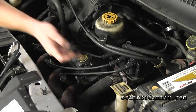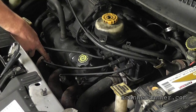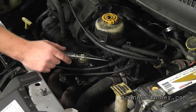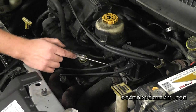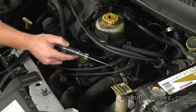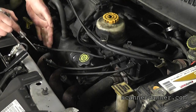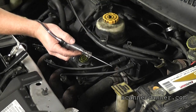The reason spark was jumping out of this plug wire was because the terminal end was bad down at the plug, and all that energy was building up in the wire and finding an easier path. So when I put my test light here now, it should not jump out anymore. Notice — we are no longer jumping out at that location. A lot of people would say that's a bad plug wire right there at the middle, but it wasn't bad there — it was bad at the terminal end, causing the high KV to find an easy path.